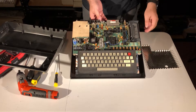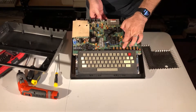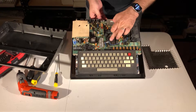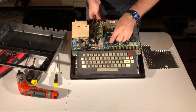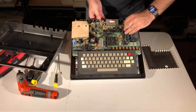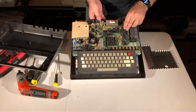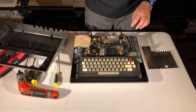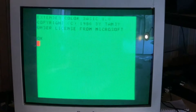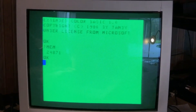I'm going to make sure I discharge myself — this machine is not plugged in. I'm going to try re-seating every chip, gently pushing on them without touching any pins. And voilà, it works! Let's try a simple command to see how much memory is available — and it works, it shows 24 kilobytes, which is correct.